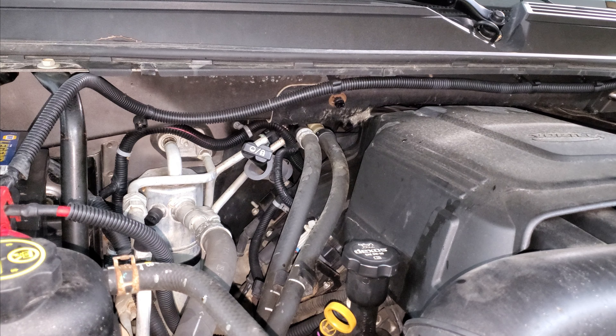I'm going to put the skid plates on. I don't like to put any more than about 15 foot-pounds of torque on those skid plates — you take them on and off all the time and they're not going to go anywhere, and I don't like over-tightening them because they strip out really easy. So I'm going to put the covers on, run the car, make sure the level's good, and call it a job.